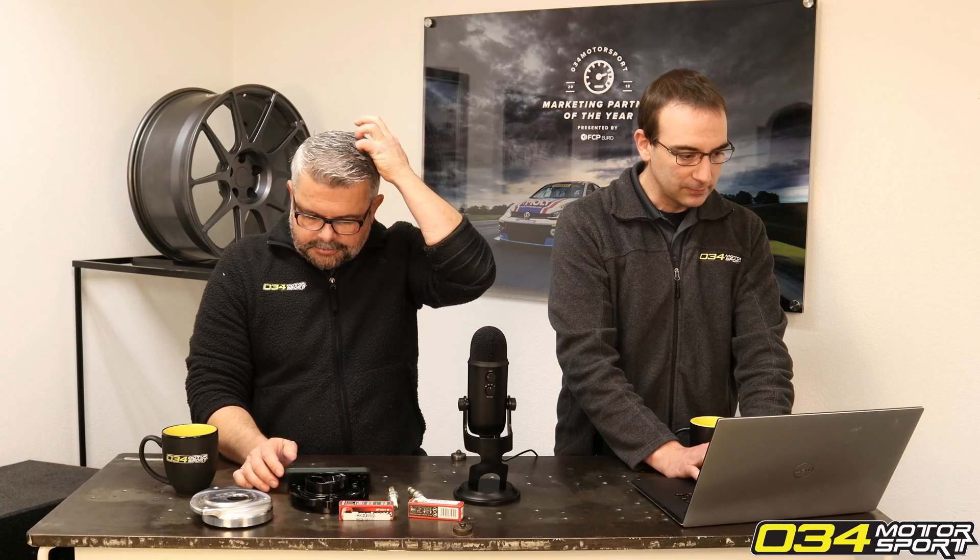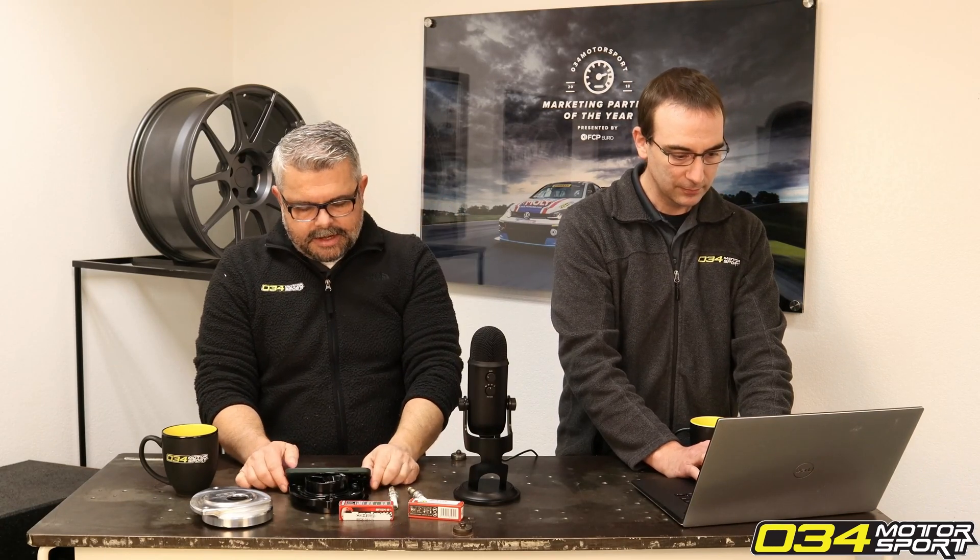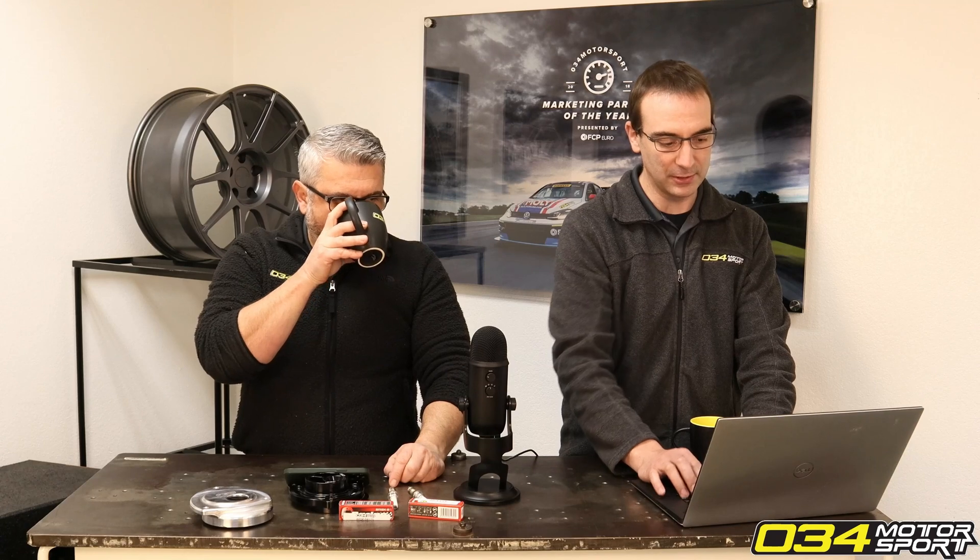Someone's asking about the new Brisk spark plugs — what's the recommended service interval? That's always a tough one because these are in such high output applications. Your service intervals are going to be very use-dependent. If you drive the car a lot, or if they get carboned up from a lot of short drives, or if you have a really rich fuel mixture even for a few moments, you can soot up your spark plugs really bad.